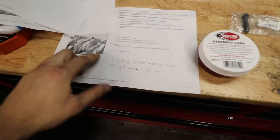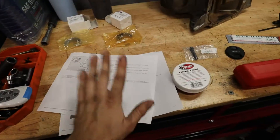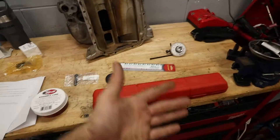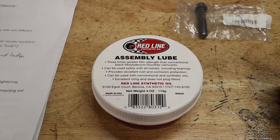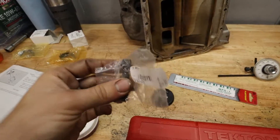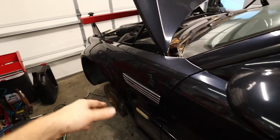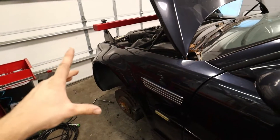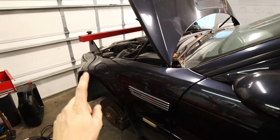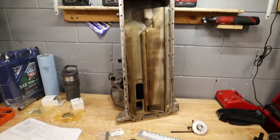Be sure you know your torque specs before you start this job — especially before you tighten those bolts — unless you're using ARP bolts, which have a completely different torquing sequence. The oil pump also has to come out, so I have torque specs for that which we'll get to later. We also have assembly lube for the bearings. The extra bolts here are actually the wrong ones for this engine — our car is an early model 2001, so we can reuse the bolts, but we have to track their exact location so they go back in the same spot.